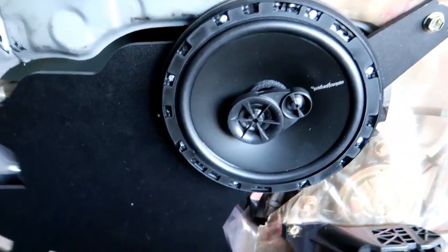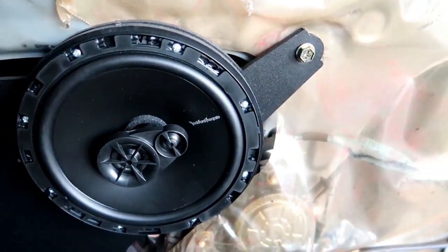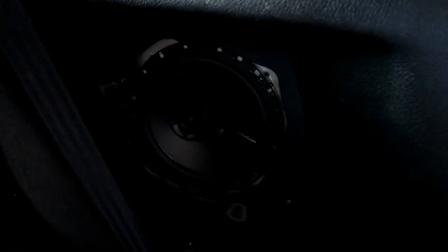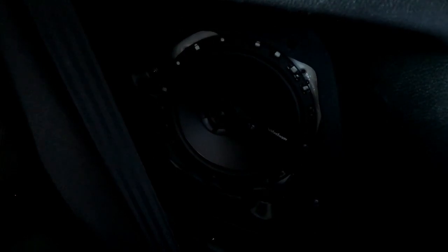Pretty much simple. I'll link where I got this in the description. The right side is pretty much done. Now I'm going to show you how to do the rear speakers. Just grab your pry tool, your speaker cover, go underneath and pop it open. This is being held by clips. There's the speakers — the stock one has four screws. Pull the screws out and pull it back out. You're going to have to re-drill new holes for the new speakers to hold in. The good thing about the rear speakers is you don't have to worry about putting an adapter. The stock speakers already have a prong so you can just buy the speakers and plug in the prong from the stock harness. You should be good to go.